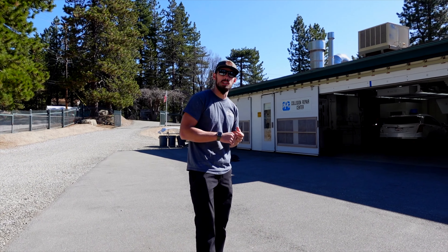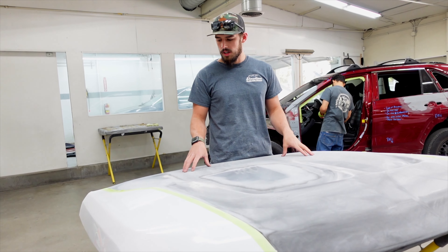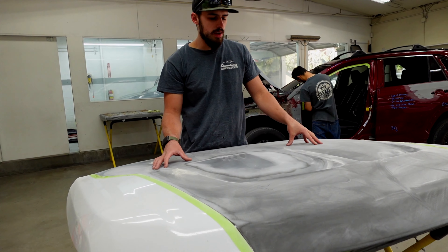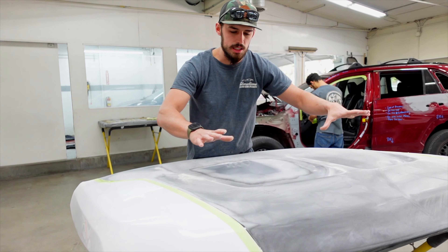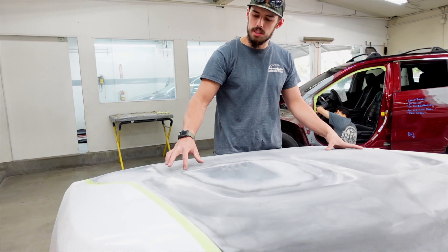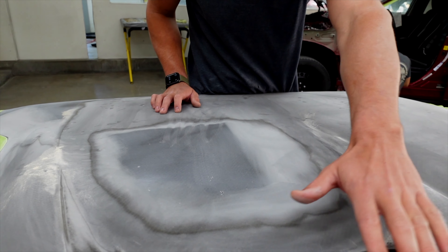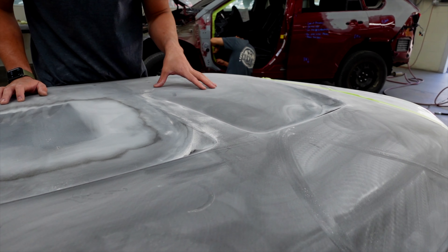Come on into the paint shop — we're going to show you the process we're going through. As you can see, if you come in closer to the hood, we've already been sanding on it. What we found is we couldn't just sand out the specific spots where the clear coat was flaking off, because when we re-clear coated it, it would leave a gray area there while the rest would be yellow. So we're having to take the whole top layer and systematically sand it off so that everything has a uniform gray finish so that when we clear coat over it, everything looks like it's supposed to.